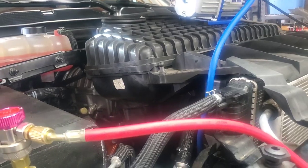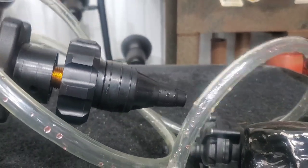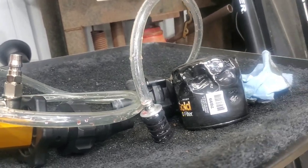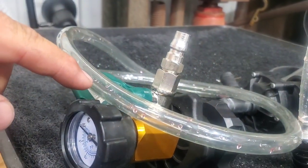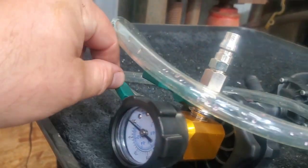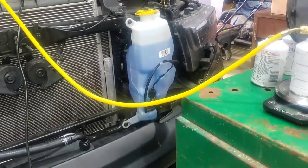Okay, it's tomorrow. I went ahead and vacuum filled — we're right at the cold spot on the reservoir. Basically, with the cap off the reservoir, you hold the tool into the reservoir, hook your air compressor to it, pull vacuum, then open the valve and it'll start pulling vacuum. When you're done, close it and open the other valve and it'll suck the coolant from the hose into the tank with no air pockets. The system sat overnight — still at 30 — so it's good to go.